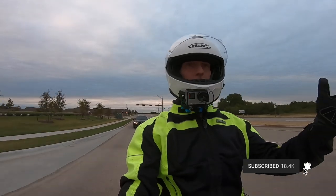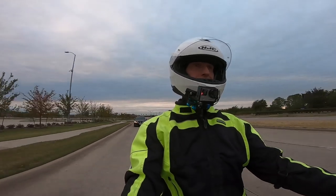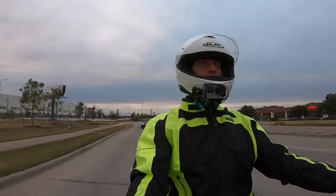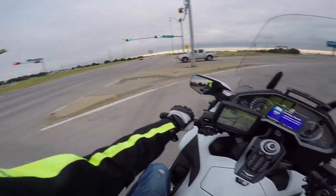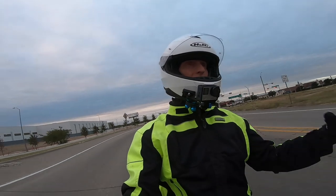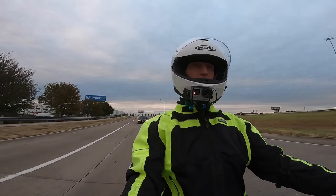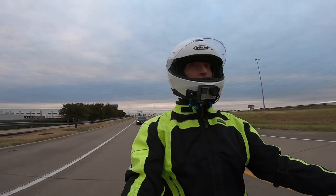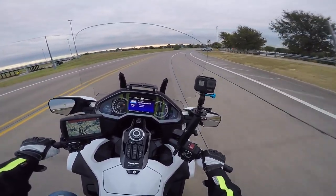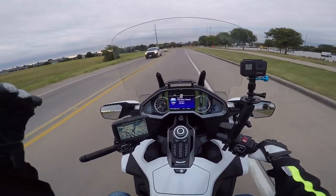For Herm - I feel your pain. I understand. My parking brake seems to work well when it's adjusted and does a good job of holding the bike in place, but it's not real confidence-inspiring if the parking brake goes out of adjustment and the bike starts rolling on you. I've had that happen in the past. If you ride off a couple of times with the parking brake on, you can end up in a situation pretty quick where you engage the parking brake and it will not hold the bike - it will just start rolling on you, and that's not good because that could cause some damage to the motorcycle.